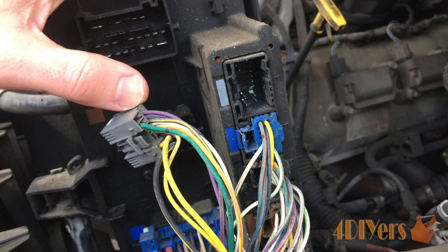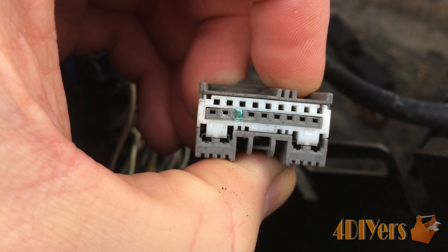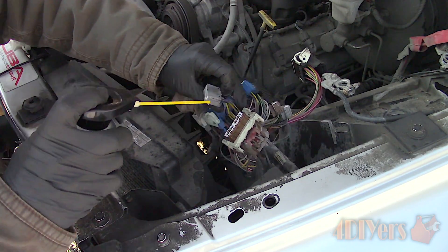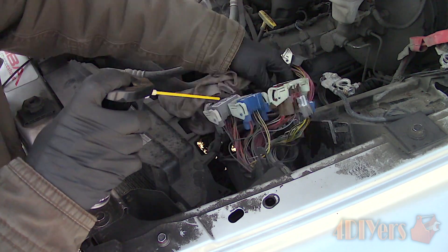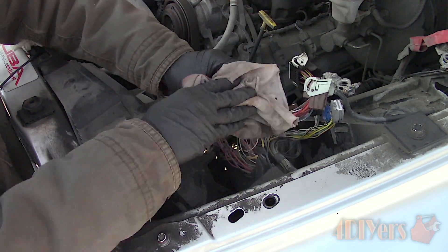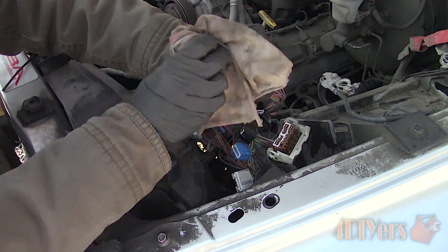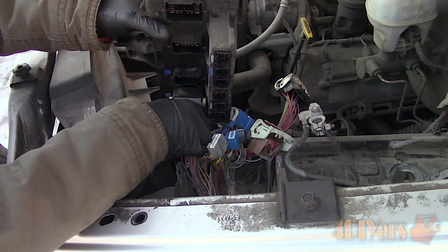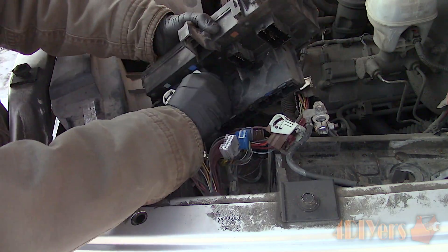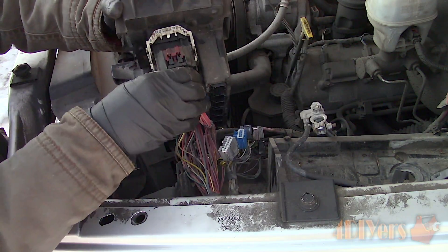Here is where I have a broken terminal. This fuse box appears to be a generic model used across all RAM models, so not all circuits are used. The pin that was broken was for a feature not equipped on this truck, so it doesn't affect anything. I was able to determine this by referencing the wiring diagram from the repair manual. Each of the pin outs can be identified using the number from the plug, color from the plug, and color of wire. If you run into a broken pin that is used on your truck, thanks to one of my subscribers, they informed me that you can purchase replacement parts — the old pin would be desoldered and removed, then a new pin terminal soldered in. If you're unable to do this yourself, someone who does electrical work should be able to repair this, which will be a much cheaper route than buying a used or new replacement fuse box module.